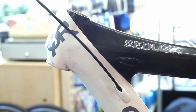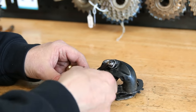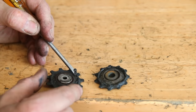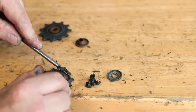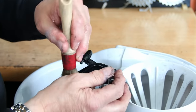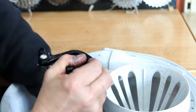With the endoscope I could confirm the tube was all in one piece, so I was confident I could remove the cable and outer from the frame tubing and get my new cables and outers back in without causing problems. That was actually the biggest concern with this frame — being able to get new cables in without that deterioration risk. If you ever get a bike with unusual cabling, always stick an endoscope down — they're not expensive and it's worth looking inside the frame.